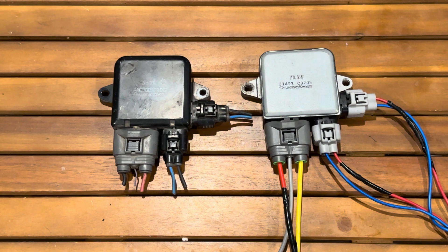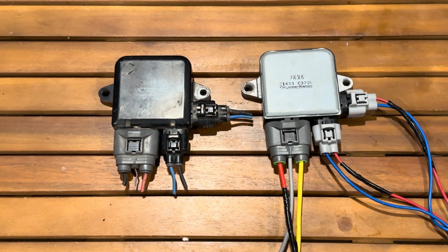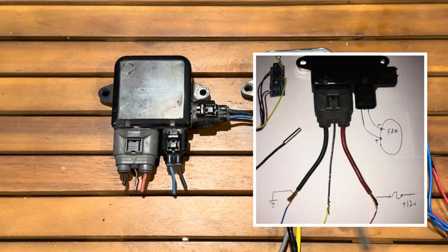Now let's get into how to wire these units up. These are polarity sensitive — if you reverse the 12-volt positive and ground wire input, you will essentially brick the unit. The unit on the left has a set of OEM plugs that I removed from a car. On the main input plug, you have your black wire on the left, which is your ground wire, your 12-volt positive high-current wire, and then the center wire is your small PWM control wire — this is essentially the wire that controls the entire unit.